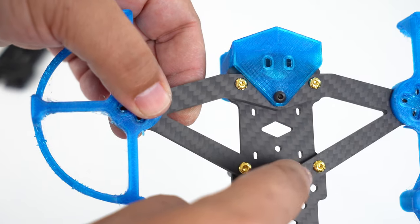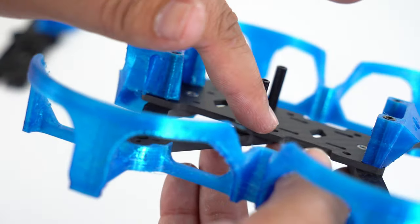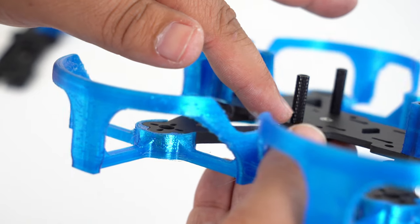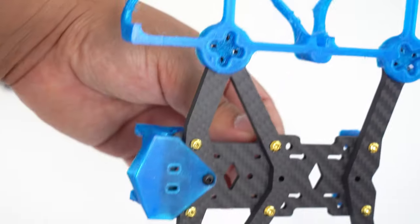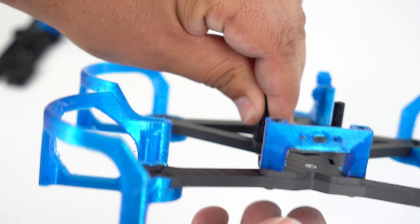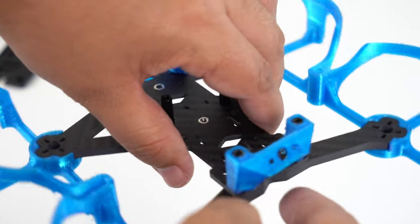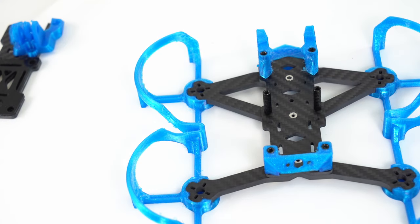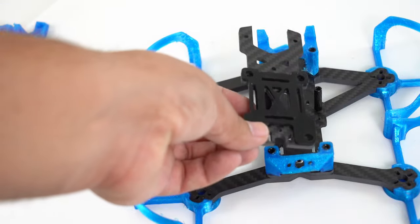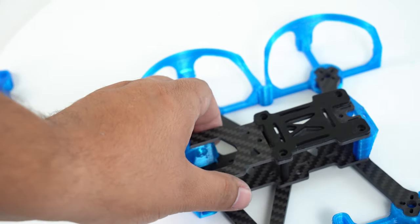Your Immortal T would go in here and then you would just use a small zip tie to secure it — very creative. The printed arm guards go on here and there's a little carbon fiber insert that goes in here to help hold the motor very nicely. I found that the hardware included was mostly unusable — I only used one piece from that kit as they just seemed too short. I wanted extra length to go up into the standoffs; the included ones only went up about 2mm and I wanted 4mm. At the back you have an SMA mount, and I'm probably going to use a lollipop-style Rush antenna back there.